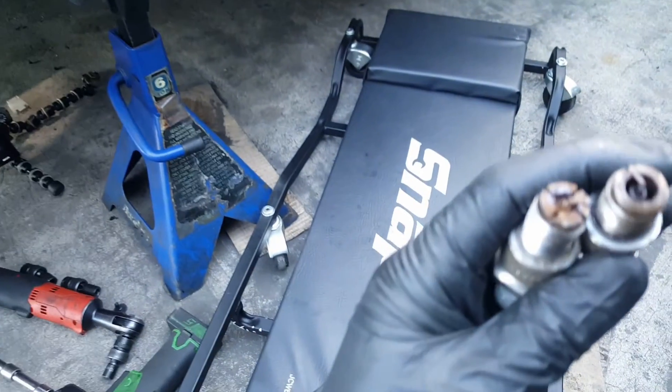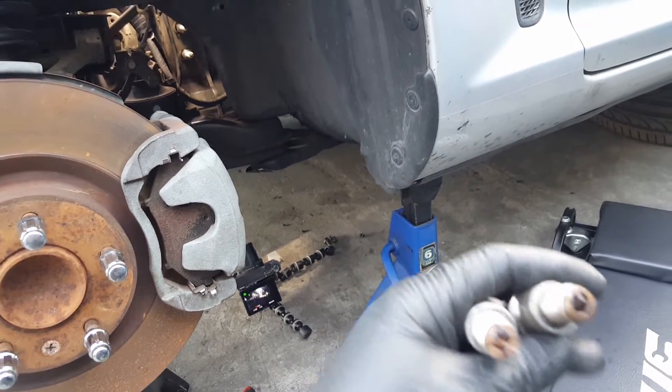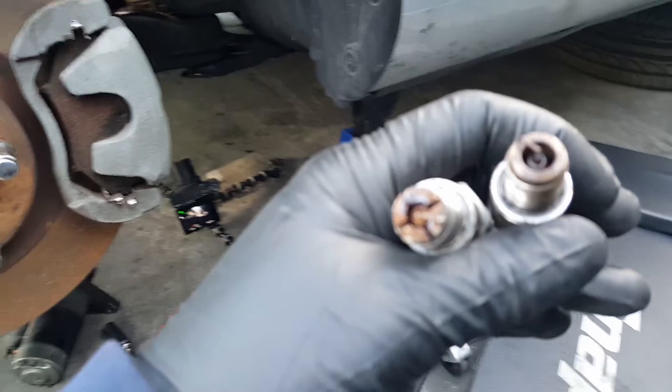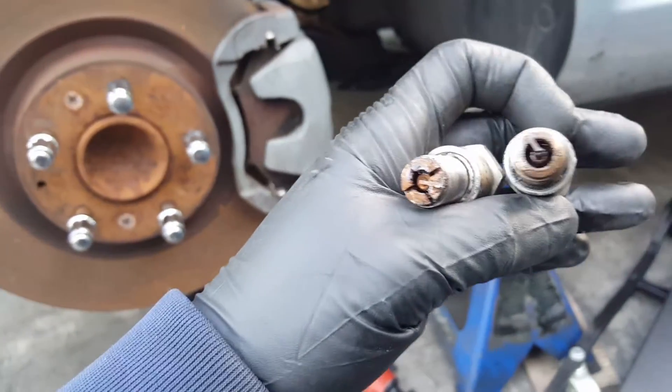The first spark plug is full of water. Most likely this car has been sitting for a long time — that's why the engine is black, full of corrosion and oxide. The spark plugs even have water on them. Look in here — see all that water? That's one of the front rotor's plugs and it most likely had starting problems because water was leaking inside the rotors.